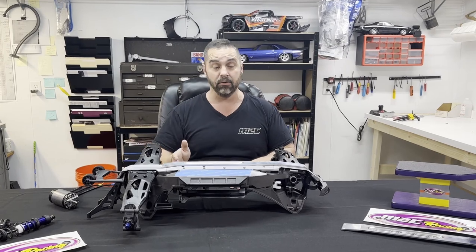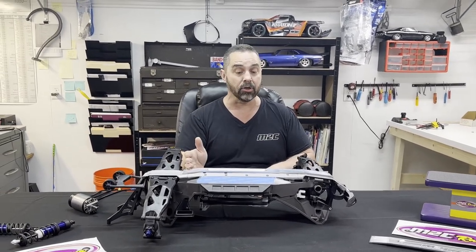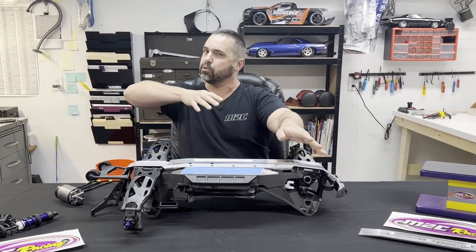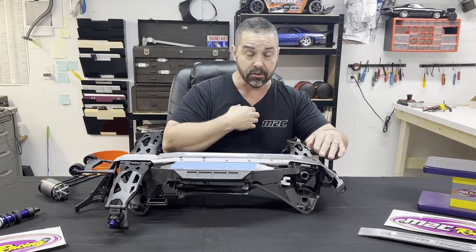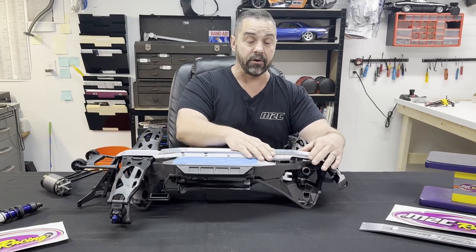What we found is that it's helping you hold your mesh and not bust your gears open, because it's supporting the back of the truck. I engineered it a little bit thinner here so we can still have a little twist in this plastic truck that we need, but we're stabilizing the front structural integrity of the front of this truck by being thick in this area.